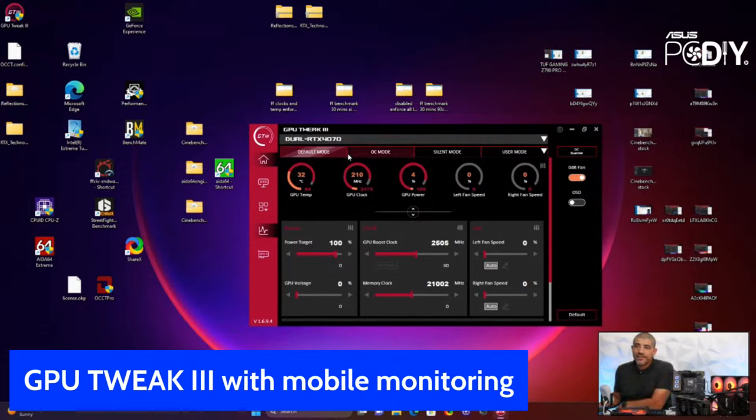Some of the cool stuff is that compared to something like MSI Afterburner, we have really easy targeted presets. You have a default mode, then a one-touch OC mode, which MSI Afterburner doesn't have. If you want a little extra performance and you don't know anything about overclocking, or don't want to use a manual VF curve, just click that button. It uses an overclock profile we've tested on many of our GPUs that generally gives you a comfortable bump in performance. It's pretty nominal, maybe 3, 4, or 5 FPS, but it's an easy way to get a little more performance.